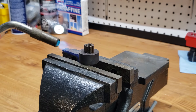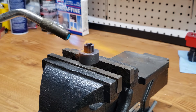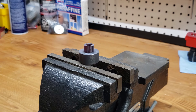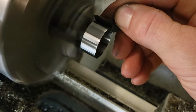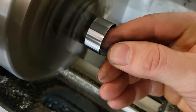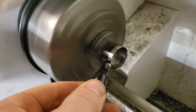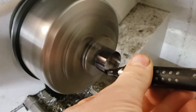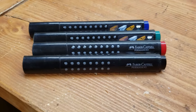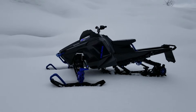Next I needed to remove the residue and surface rust. I tried scraping some of it off with very little success, so it was time to bring up the heat. Then I put to use one of my new favorite tools — the lathe. I started with 400 grit sandpaper and moved up to 600 grit for a nice finishing pass, and it came out beautifully. Since the clutch bell will rust very fast in an RC sled, I decided to give that part a special treatment — I call it the permanent marker coating, and it is surprisingly efficient at preventing rust. My favorites are the Faber-Castell Grip Permanent markers — I've had those for more than 6 years and they're still like new. I highly recommend them.